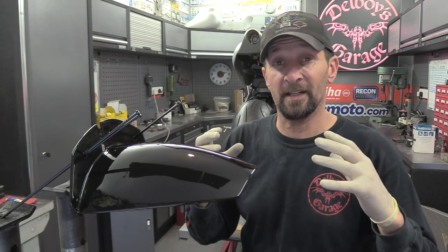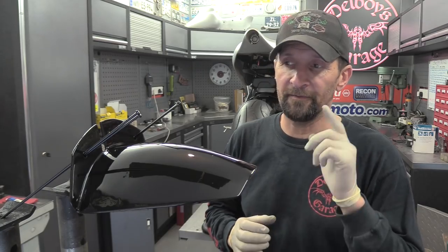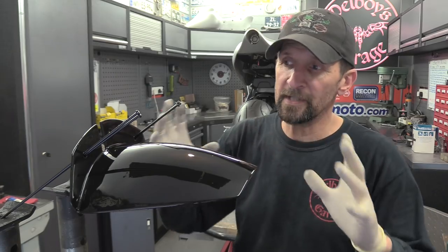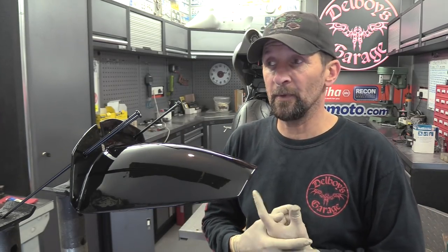It would be too much. It's extremely heavy paint and it would sag and run quite quickly. I found the best solution is literally what I've done: two good wet coats so it floats out completely, and leave it, that's it. Otherwise it would take about 3 months to dry, and I'm not exaggerating with that,